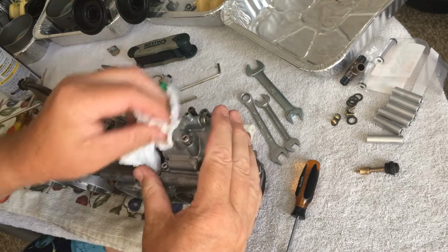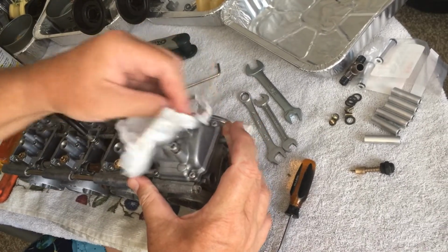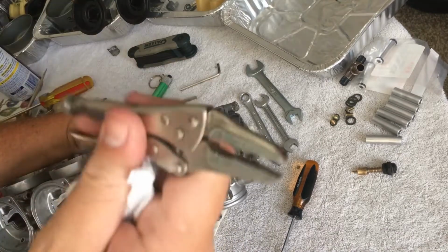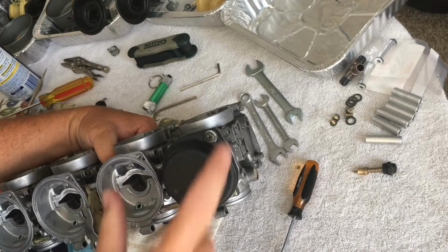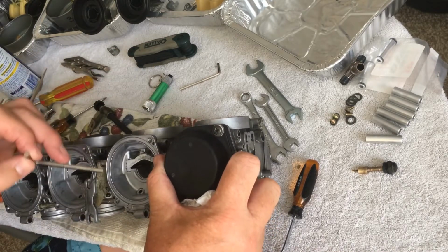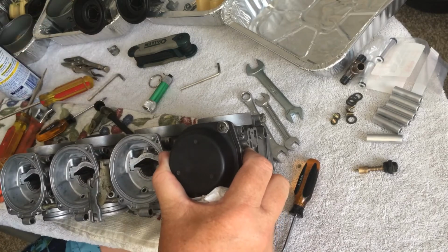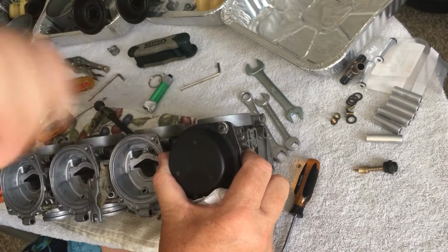That's my main thing. Now, I will tell you one thing this guy did that I always do, but he did it a little differently, is these screws. If you watch my disassembly video, the first screw on here, I had to use these little pterodactyl, T-Rex looking channel locks to get this off. And sometimes, if needed, like when there's four screws and not really a lot of room to get in there, I will actually Dremel out the sides to make one big long opening, and then I'll grab a great big flathead and get in there with the sides knocked out, and it cranks open every time.